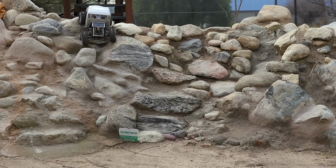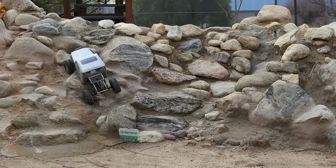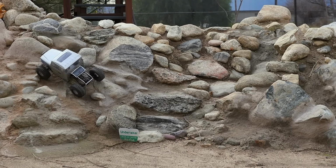Element, your pinion gears are too small, man. Hold that pinion gear up to an AR-44 pinion. It's tiny. And because it's tiny, it has less depth of engagement, so you have to shim it very precisely. And even if it is shimmed very precisely, the inner bearing is too small. Yes, they corrected that going to a bigger bearing, and they went to a 5x12, which is not a normal bearing. 5x11, everybody's got those. 5x13s, everybody's got those. Even 5x14, but 5x12, I had to buy 5x12 bearings specifically to fit SE axles.